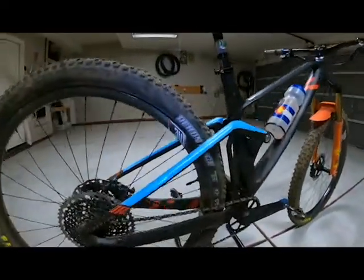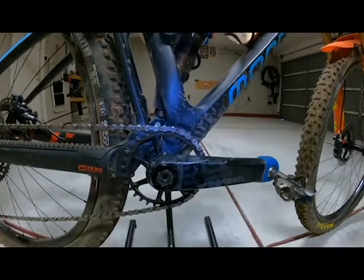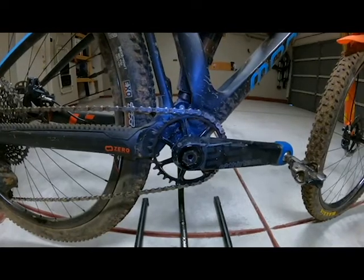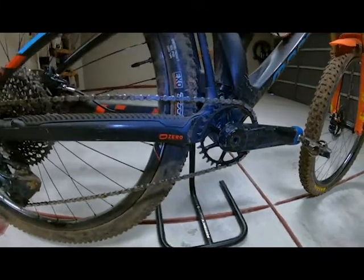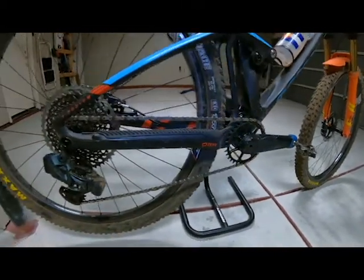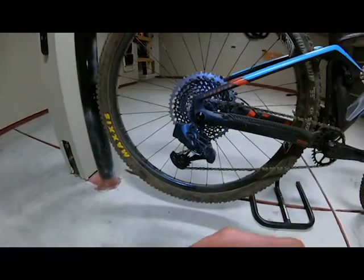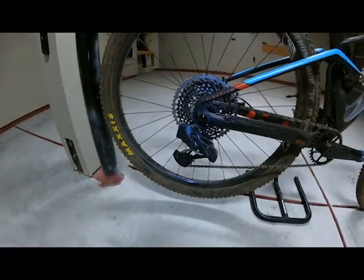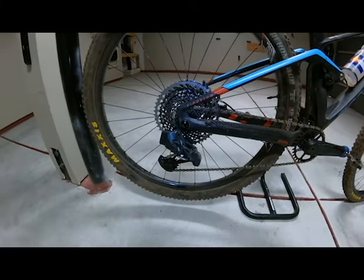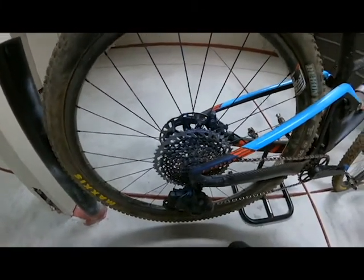The We Are One — running a Faction in the rear mostly for weight purposes. E13, I'm doing their TRS Race — you can call it their gravel crank or cross-country crank, it is stupidly light. I can't get an oval for it so I'm running their ultralight with a 34-tooth chainring. You can see I've smacked that thing a few times. The nice thing about an AXS derailleur is you can smack it hard and not knock it out of alignment or mess up the derailleur hanger.